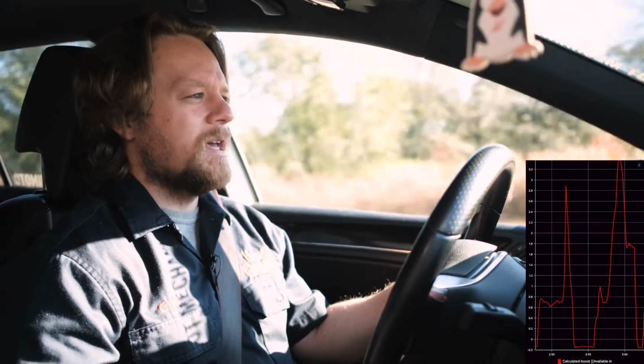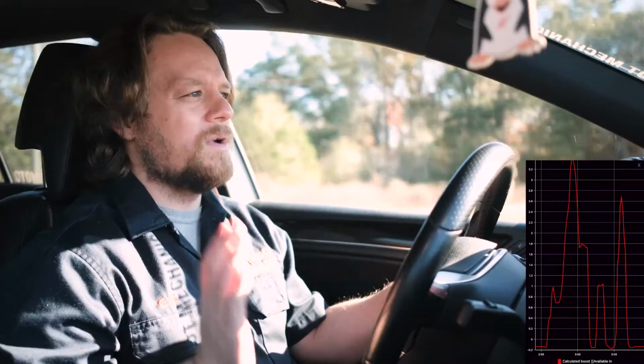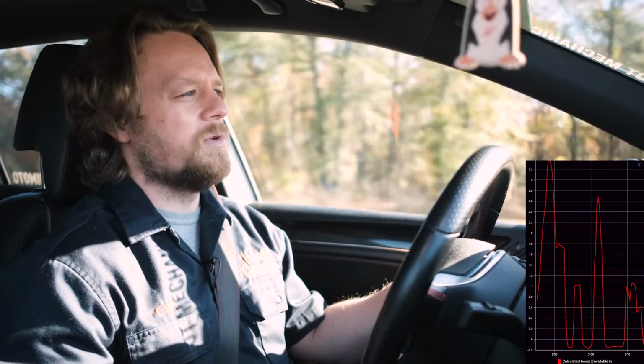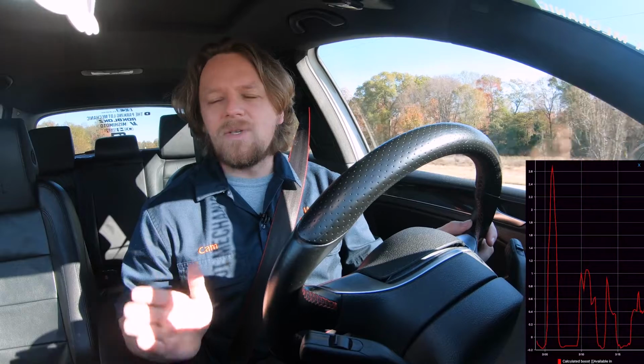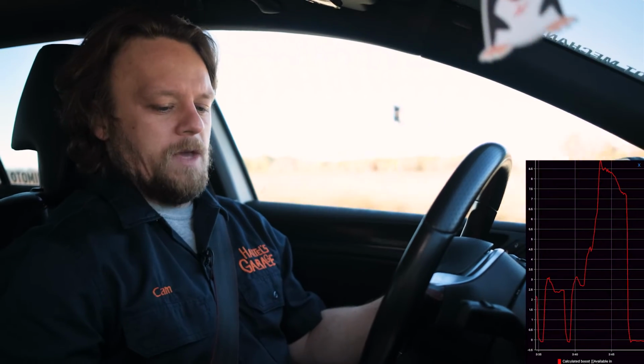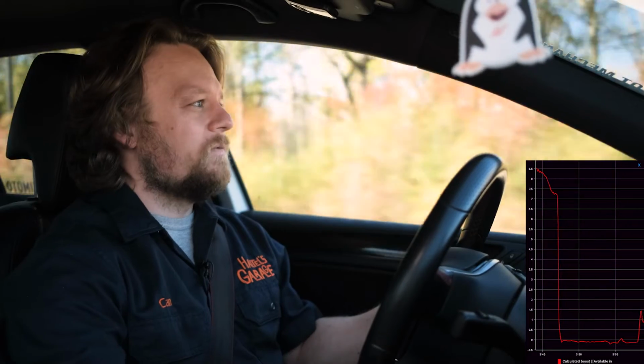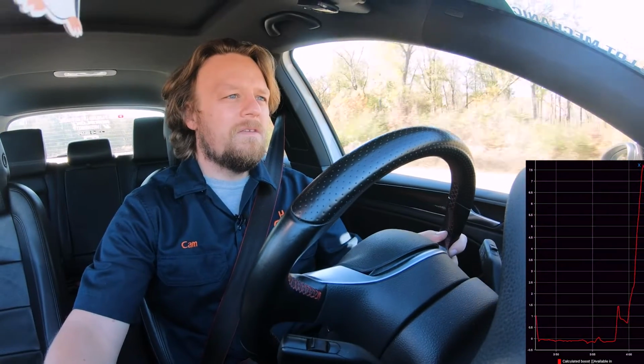Unfortunate, but we're back. We've got the sensor getting some boost readings, and we're gonna do some acceleration just in gear to see what boost we have. 8.8, 9 PSI was where we were at with this 034 stage 1 tune. Did that off camera, some testing. So we're trying to get 10, 11, I think would be nice. We're gonna see how much PSI we've gotten back. I'm not too concerned about acceleration, so I'm just gonna push it down. Okay, we peaked at 9. That's actually higher than what I thought we were getting before. I'm just gonna do 5th so I don't lose control of everything.